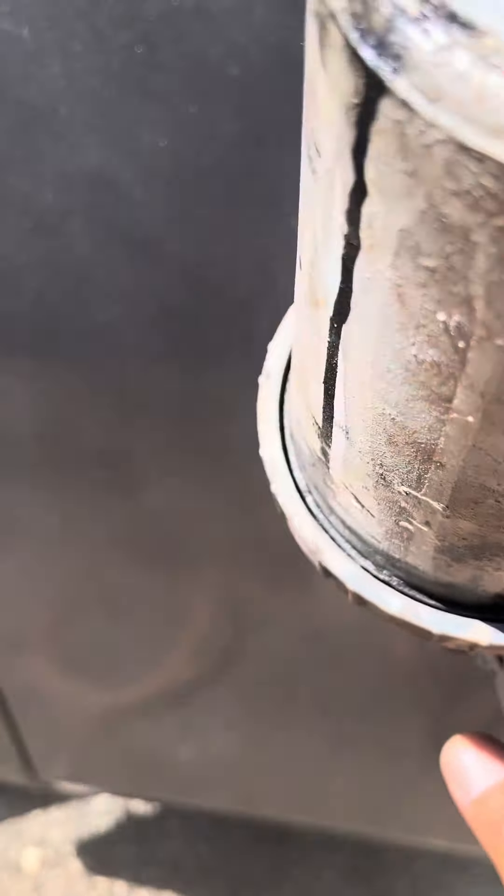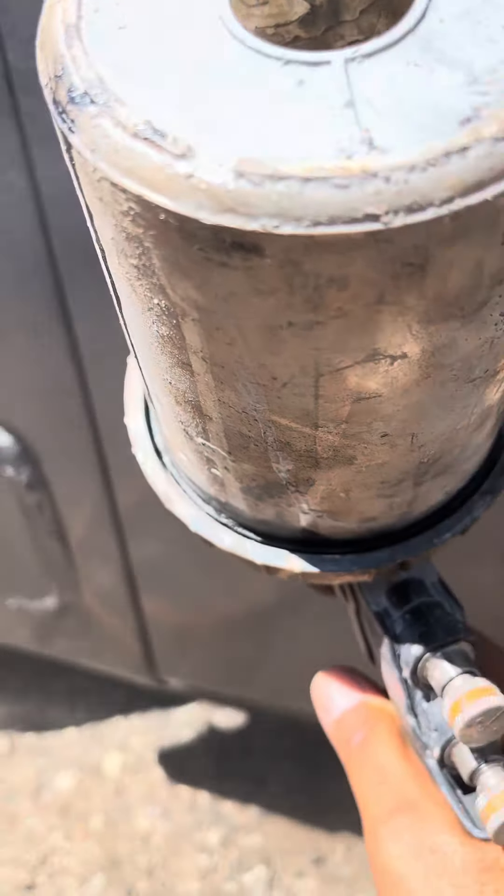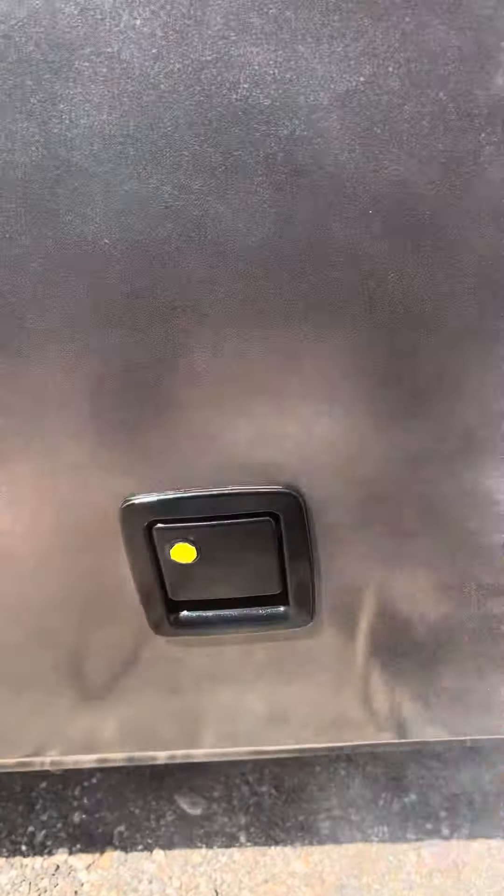Now I've got my high glamour coat — very little reduced. The only reason it's reduced at all is to come out of the gun, because at 100% it's very thick, the atomization is very high, and it doesn't leave it very shiny. Here's my gloss coat coming on — you'll see how the reflection is looking beautiful. And I've gone over my limit for the video, thank you.